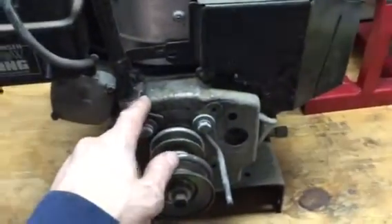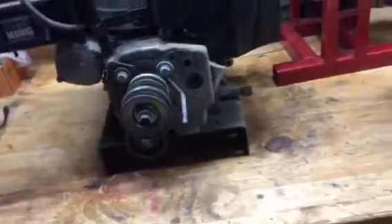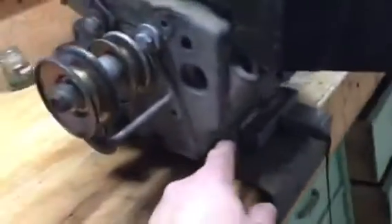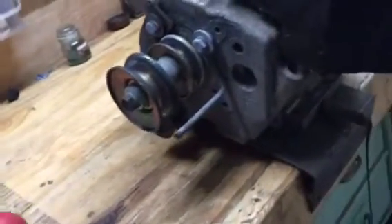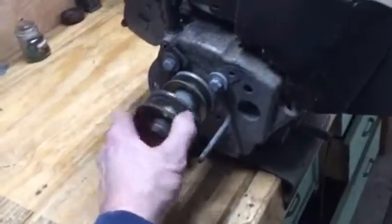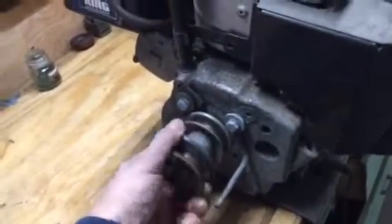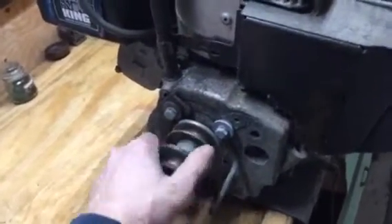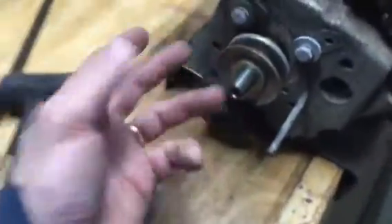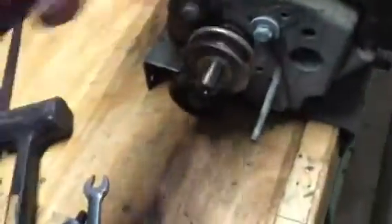The main thing I want to get out here is the rod. I'm going to be pulling this apart. First thing, pull off the drain plug — get all the oil out of it, because when you pull that cover off the oil's going to be everywhere. We want to pull off this engine cover, and I believe there's a gear reduction in here. I'm surprised that turns over. I think the rod let go this time. I'm just pulling the pulleys off — maybe it is the end of the crank. I thought there was a gear reduction here because it was so big, but we'll find out.